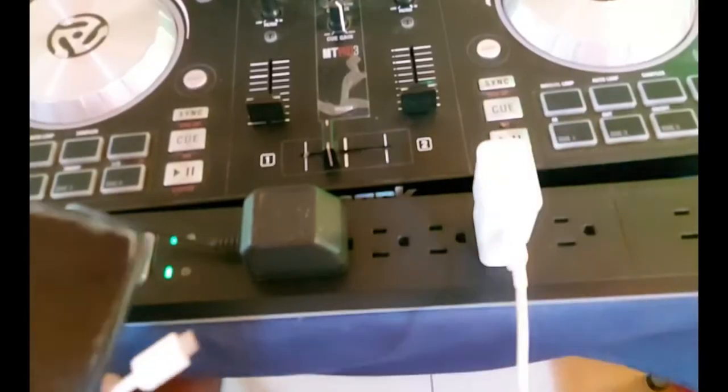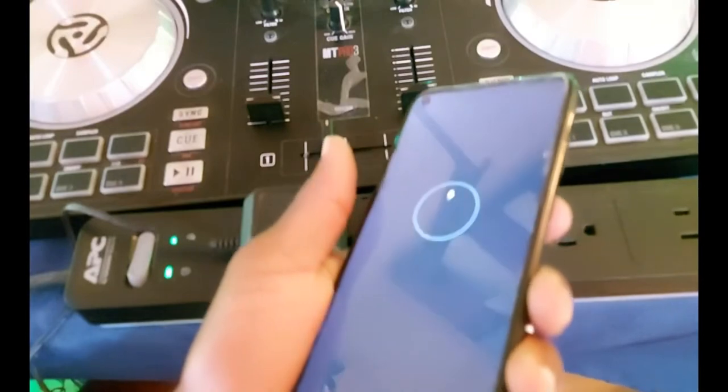let me just mention that when you swap in a brick to test it, you have to ensure that the brick works properly. You want to eliminate that, make sure that it is working okay before you introduce it into the troubleshooting process. You may even want to take your original brick and cable and connect them to another device, to see whether it is your Samsung tablet that is the problem, or possibly the brick or the cable. All right, you see how simple these things are.